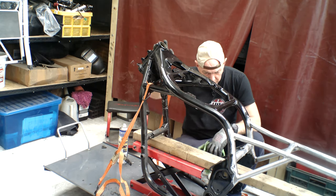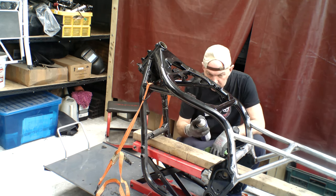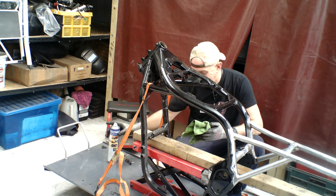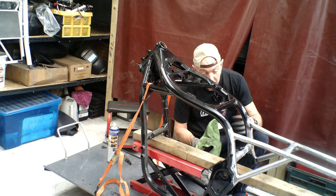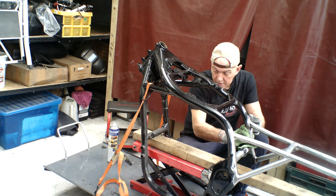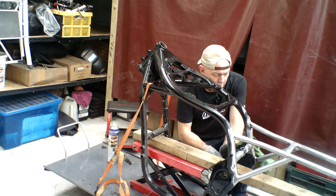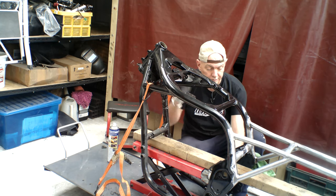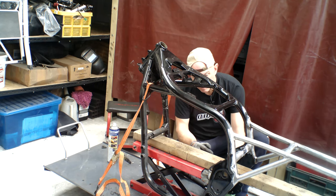And coming onto Clearways, which is a properly quick corner, it's all bouncing around and everything. This is on the Grand Prix circuit. And I ended up crashing there as well. And the reason being is that I'd actually damaged the frame. Because then we took it right down to the frame, we measured everything up, and it was properly out of shape. And the front wheel was twisted at the yoke, which on that frame is quite a thing. That was a ZX6R.